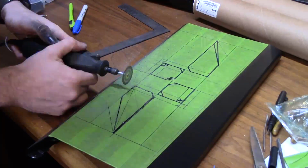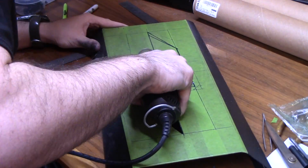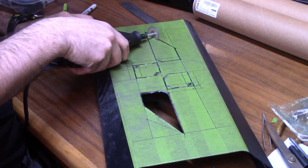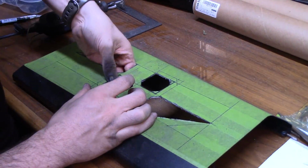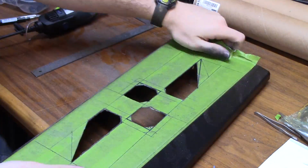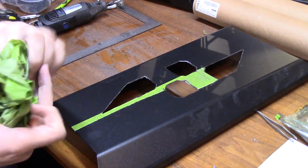Unfortunately, the stock P400 does have a little bit of an airflow problem. The intake fans just take air from the top and bottom little grills on the front panel, and those are pretty small, so the intake fans are a little bit starved for air sometimes. Now, even though I do value aesthetics pretty highly, I don't like to trade out functionality just for the sake of something looking good, so I decided I wanted to cut a couple holes in the front panel to help out with the airflow intake.